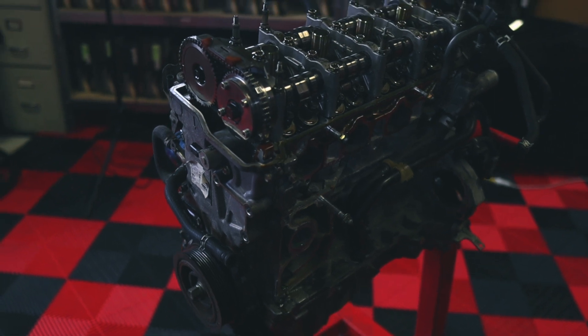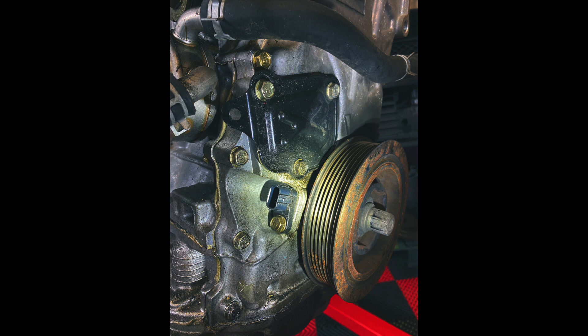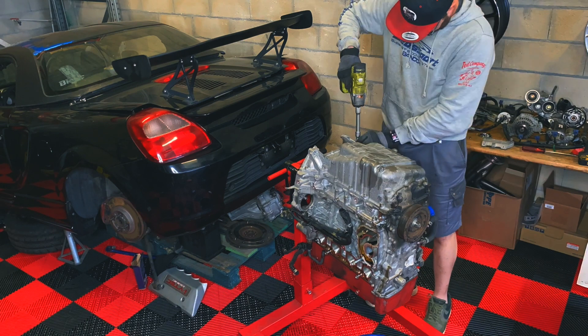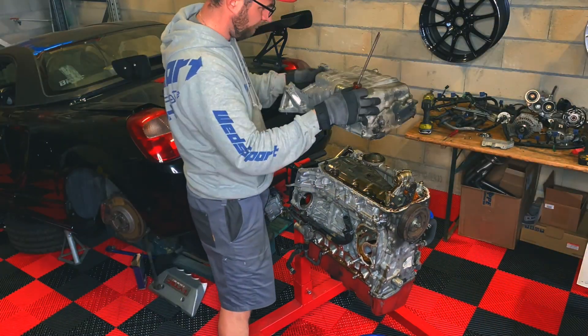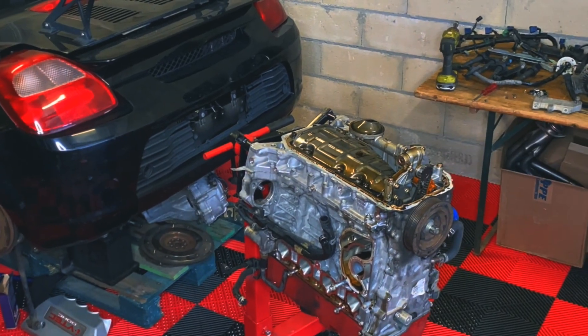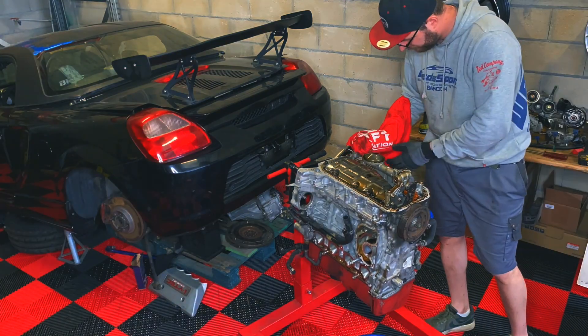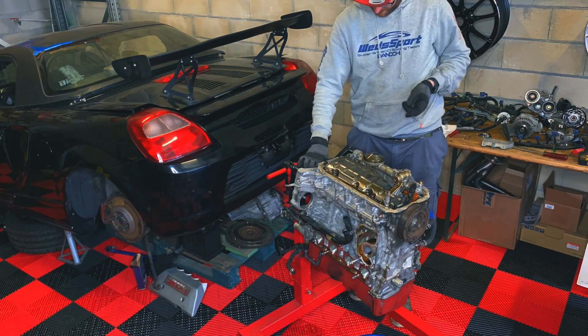Here you can see a couple of oil leaks I could spot: one on the side of the cam timing cover, next to the pulley, and at the bottom of the oil pan as well. So those are areas I'm going to have to address and make sure I fix once I'm reassembling the engine. So let's remove the oil pan here. I like to use a little screwdriver to pry on it a little bit — make sure not to damage it — and give it a quick clean inspection. You could see I was talking about brown things; this engine is a little bit brown at the bottom, but it actually comes off just by wiping it. So it's actually a fairly clean engine on the inside, which is very relieving.